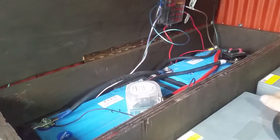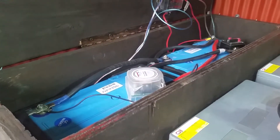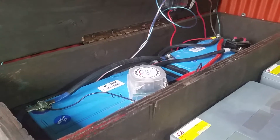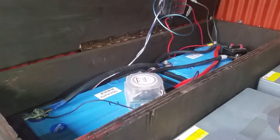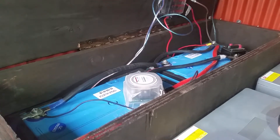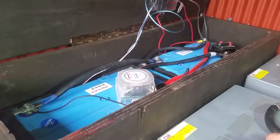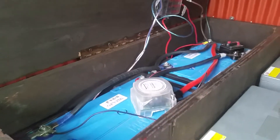The van's powered from this battery bank, but they drain and have to be recharged. Deep cycle batteries are different from a starting battery — a starting battery needs to stay above 90% all the time. Deep cycle batteries are designed to cycle down as low as 50% and then recharge. A set like this can go through 300 full cycles and last about 10 years.